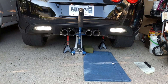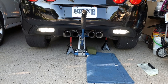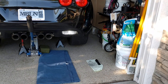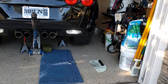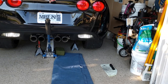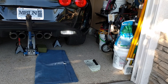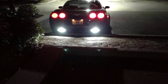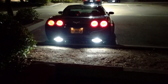Okay here it is with both of them in. I promise I will take one tonight when it gets dark and show you both of them. Also Froggy tip: on the passenger side when you twist that socket, twist it down. Driver's side you twist it up, passenger side you twist it down, and it'll come out nice and easy. Okay, I'll see you tonight — and there it is, those are my low beams on the front lighting up the front part of the car, but there are the backup lights.